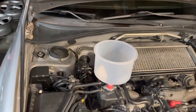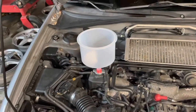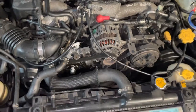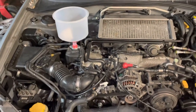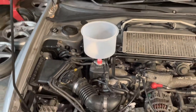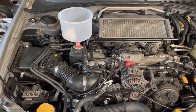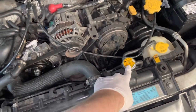That will hold the coolant whenever you go to put it in. One thing I want to mention: you may not need the specialty funnel, but it is really nice because you can massage or squeeze the hose and it will burp a little more of the system out. It also holds the coolant and you can plunge it to keep coolant in there when you go to take it off if you overfill it.